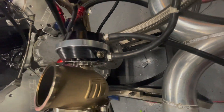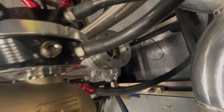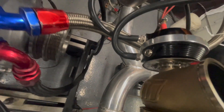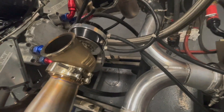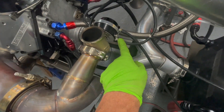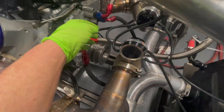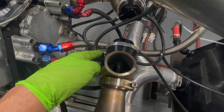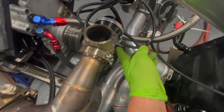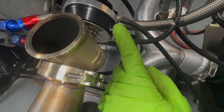If you take a look at these really badass 50-millimeter Turbo Smart wastegates, they came with the fittings already kind of in there. See how you've got those two ports at the bottom of the wastegate - I did not know that these wastegates came water-cooled. What I had done was put a fitting here instead of there. We were getting the boost source right here off the charge pipe going to one wastegate, and since that's kind of a common volume, I just went from here to the other wastegate and to the boost controller.